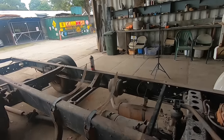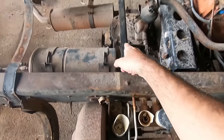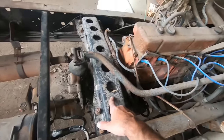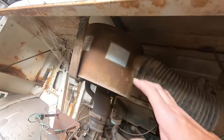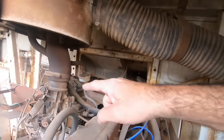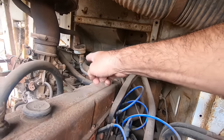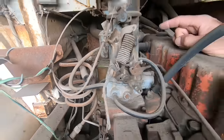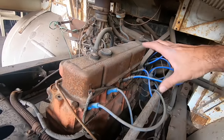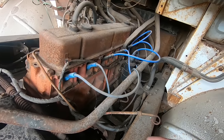Alright, so here's the plan of attack: I'm going to get rid of this air reservoir. I'm going to cut these rivets off, remove that cross brace — it's like a strengthening brace. I'm thinking we'll jump in under here, remove this air box, air cleaner housing, hose, carb, and we've got some miscellaneous hoses up the front. We've got the air compressor tucked in under there — a lot of piping. I might just chop that because we want to make this chassis line clean. Anything that's redundant under here, just bin it.